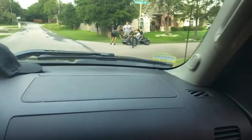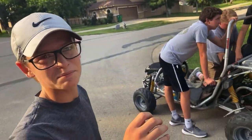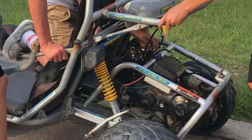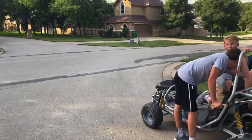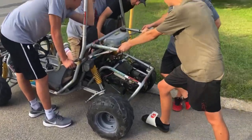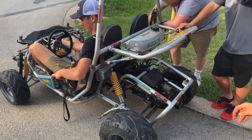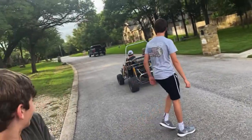We have a problem — someone drove it and it is now dead in the middle of the road. So we're going to go save it. Basically what's happening is the little intake piece is a little bit crooked, so when they're trying to run it with it being crooked it's just sucking in a bunch of air through that — too much air. So it's back to square one. He just messed up the carburetor.